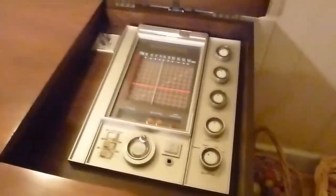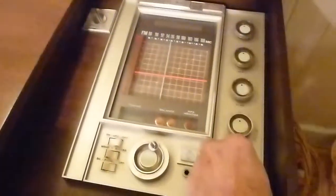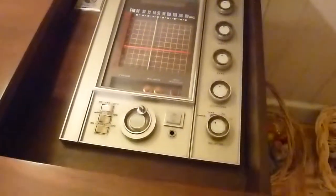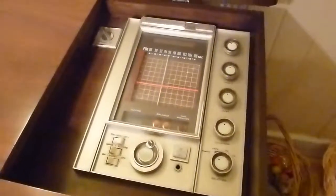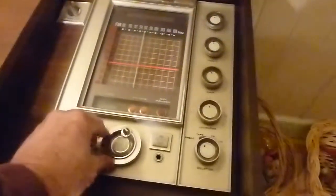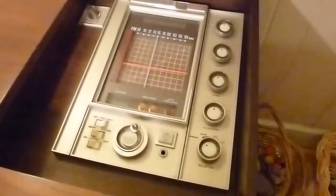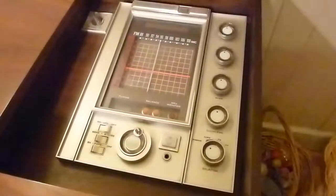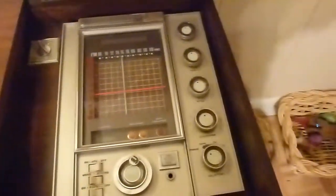On this side over here is where the amplifier and the tuner are. Last time I had it powered up, whenever I touched one of these plastic knobs I actually got a shock. I think something is shorted out inside there, and even though the knobs are plastic, there's some metallic coating that was conducting 110V AC — not a strong shock, but enough that you could feel it.